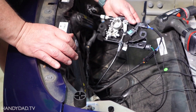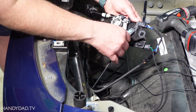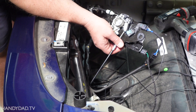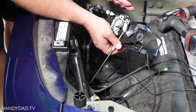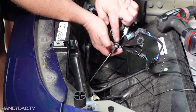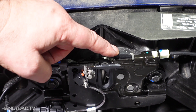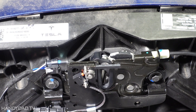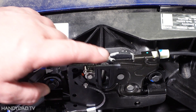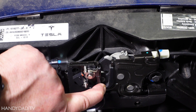One of the problems I was having was that the latch was already latched when I adjusted it, so it was not testing correctly. The first test is you push the button twice and it does a partial pull but releases — that's correct. If it does the pull and latches in the half-latch position, then it's too tight and you have to loosen it up. The first time you double click, it moves the latch but doesn't pull it down into a latched position, so that's good. If it does latch even in the first latch position, it needs to be adjusted. Then the second test is you hold the button down and see if it latches fully when you double click — and it does.